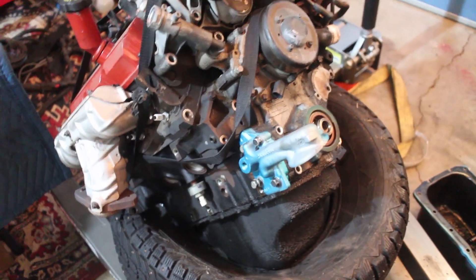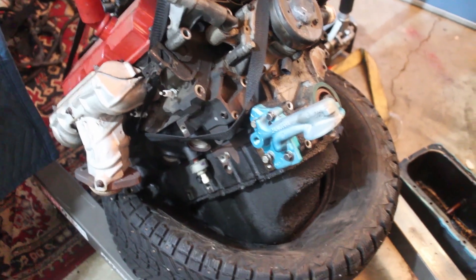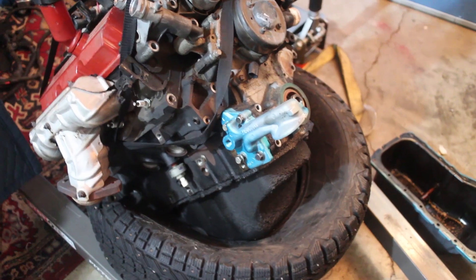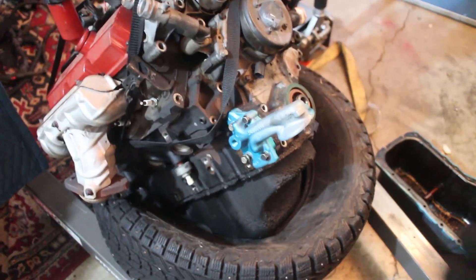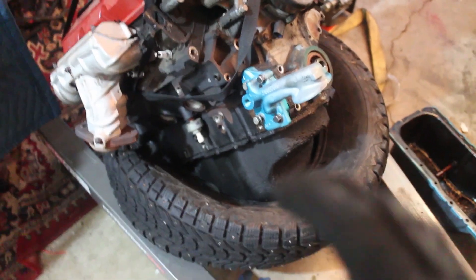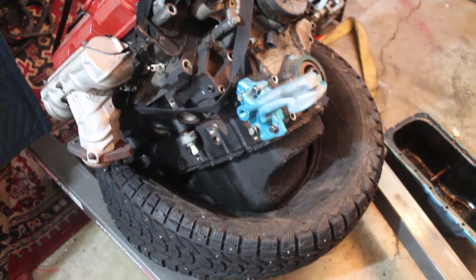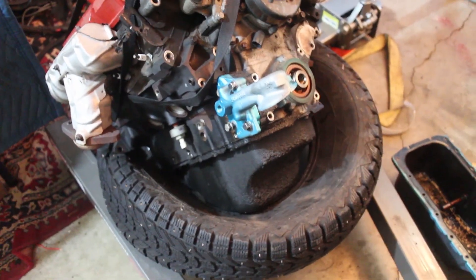The pan is super dirty. Also interesting — someone had lifted up the engine by the oil pan at some point, so it's kind of dented a little bit. We're gonna have to flatten it out. It's not super bad, just right at the bottom — easy to hammer out with a mallet. So I'll loosen the bolts, lift it up, remove the rest, get the new oil pan on, maybe just a couple bolts — we don't need all of them — then lower it back down safely.